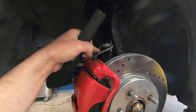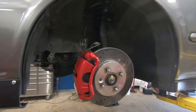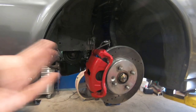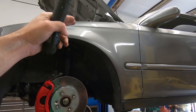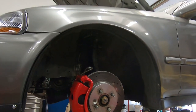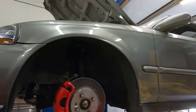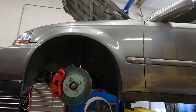If you want to go the extra mile, you can also get replacement brake lines. I went ahead and got stainless steel brake lines all the way around — regular Civic brake lines will fit and bolt up to the ITR calipers. I highly recommend you upgrade your master cylinder. I installed it with the stock master and it felt better, but once I installed a different master cylinder it was night and day. On EK and EJ Civics it is a direct swap for the ITR master cylinder. If you have a DC2 Integra, you want to go with the GSR master cylinder, because the brake line setup is a little different between the Integra and the Civic.